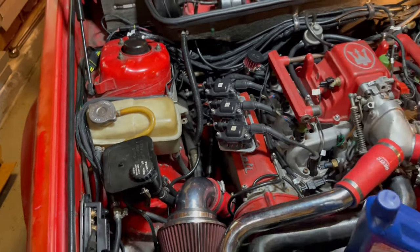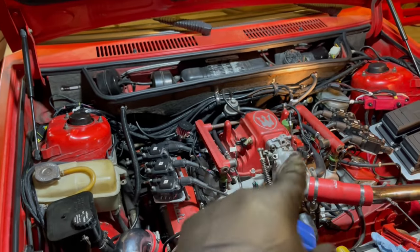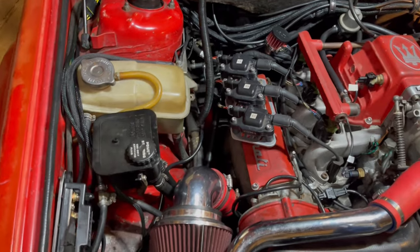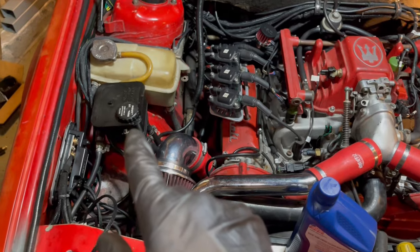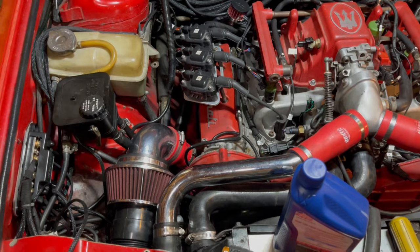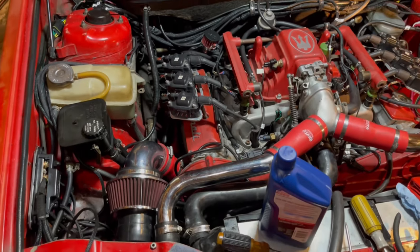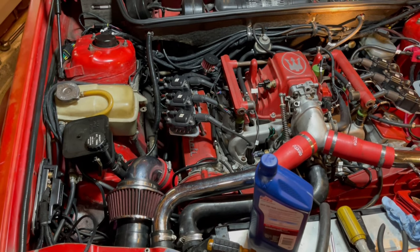Now, I will need to start the car and cycle the pump by turning the wheel all the way left, then all the way right, doing that a couple of times until the reservoir levels off. It is pouring outside, so I'm not going to be able to do that part today, but I can fill up the tank to the point where it won't fill the return line, but at least it'll fill up the tank and this feed tube. Next time I get some sunny weather, I'll just start it up and cycle the pump. But basically that's all there is to it.